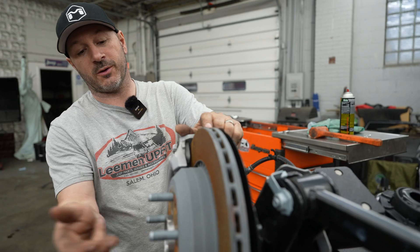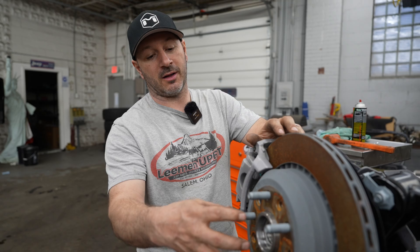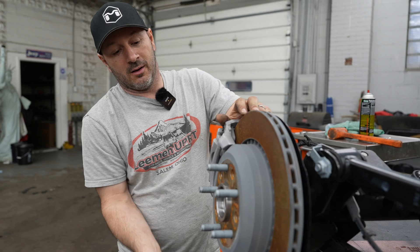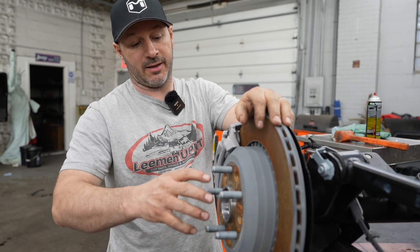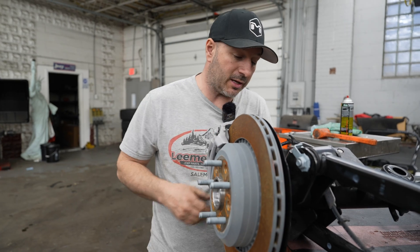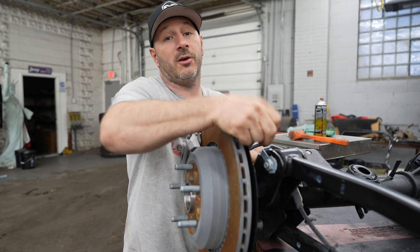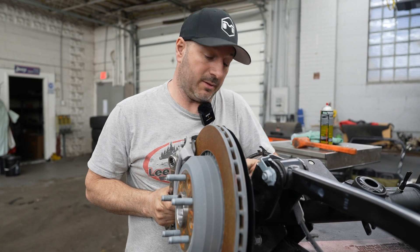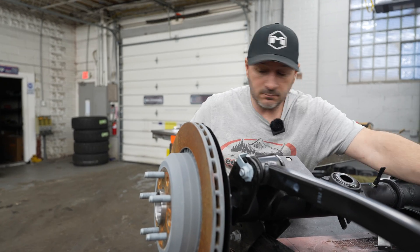So what we're going to do is tear this off so we can look in here. I want to see what this full float looks like. Normally on a full float, like on a one ton, you would have a hub stuck out with an axle shaft, a bunch of bolts where you pull your axle shaft out separately from the hub. This one's a little different. I'm assuming this axle shaft is splined on each end and goes through this bearing, kind of like a front wheel drive car bearing. So we're going to tear it apart and see if that's what it looks like, because I'm curious, and I figure there's probably a bunch of other people out there curious who either don't want to tear their brand new one apart or can't find anything on it. So I'm going to be the guy to tear this one down. It's not overly complicated, but we're going to see what this one looks like.